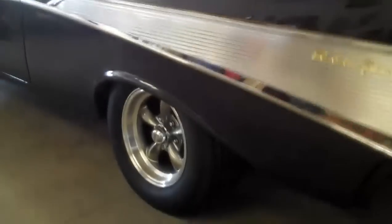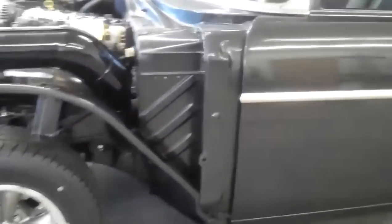I should add that I'm only 21 and I built this car entirely myself with some help. I did all the paint work — well, my friend actually sprayed the paint, but I did all the body work. I replaced the quarter panels, replaced floor sections, rockers, inner rockers, a whole bunch of floor braces, the tail panel's been replaced, part of this tail fin's been replaced. It used to have an old big block in it, the frame was bent, it was in pretty bad shape — front floor pans were gone, floor braces were gone, rockers were gone.